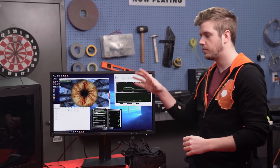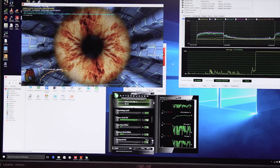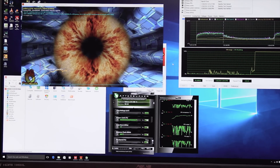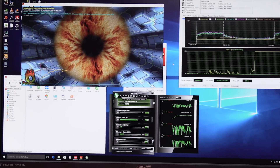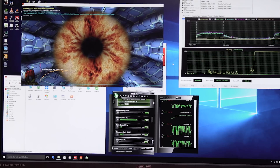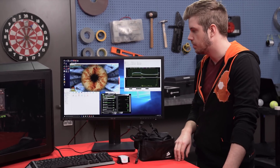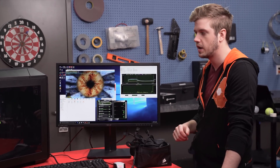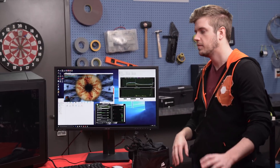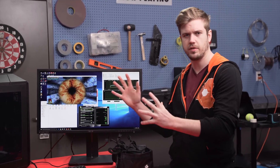The case is all closed up and now I'm doing some testing — this is going to run for about 10 minutes total. I'm running FurMark on the GPU and recording temperatures using MSI Afterburner, and then running a system stability test with AIDA64 to push the CPU. This should heat everything up and get us to hopefully high numbers, although this isn't a particularly hot graphics card and the Hyper 212 Evo is probably going to do fine since nothing is overclocked.